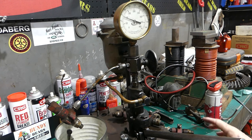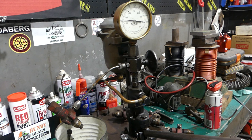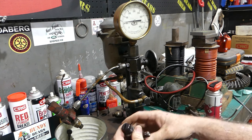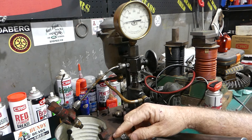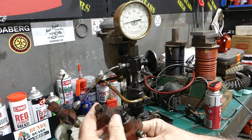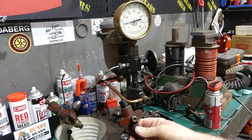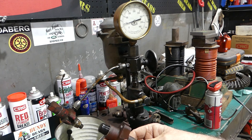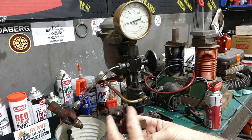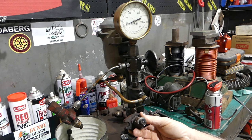What we'll do — I'll test all the injectors. I have tested all four of them and they're all the same. So now we'll turn my stand around — I have a little piece on the back where I can undo them and we can get the nozzles out and have a look at them. I've undone the top cap there — that top cap locks the adjusting screw in place on the injector. I'll bead blast all the nuts and the bodies, and I may even try lapping the nozzle to see if I can get that to seal a little bit better.